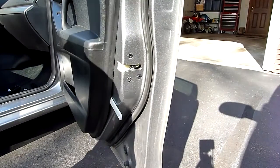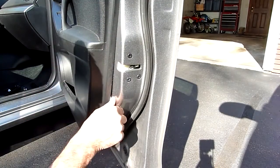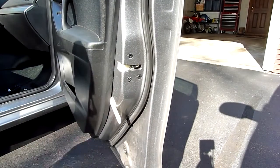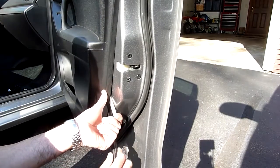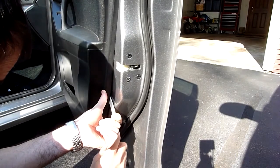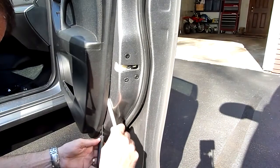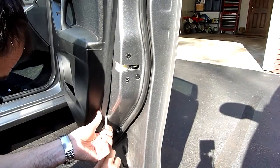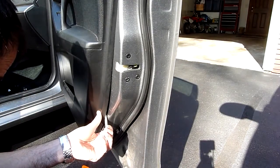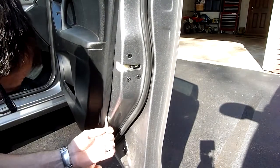There are fasteners around the outside of the door. I get a tool in to create a small gap, then slide it along to find each fastener so I can put pressure on it. I use something that slides easily without scratching — as you slide along and hit resistance, that tells you there's a fastener. Then I just pop them one by one all the way around.